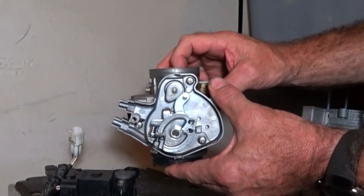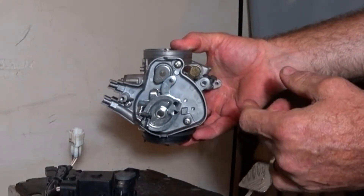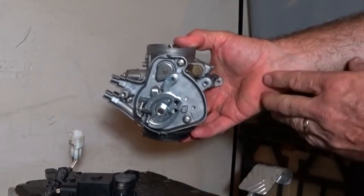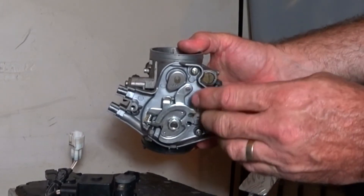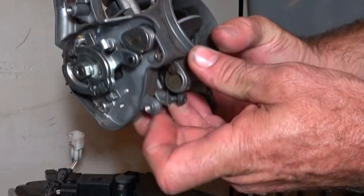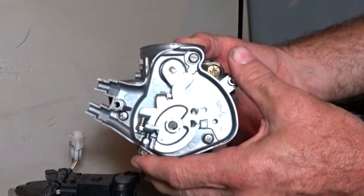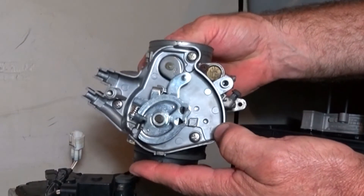A fix we came up with quite early on — we couldn't find a fix, none of the dealers were able to help us, and BMW never came up with a software change or anything to cure it. What we do is use a Dremel or a small tool, grind this stud off the little roller that's behind there that the cam operates on, and we remove that axle and roller with a small punch. Then this shaft can do whatever it likes and has no bearing on the primary throttle.